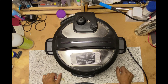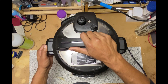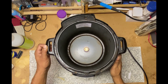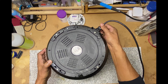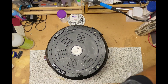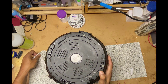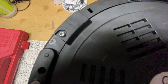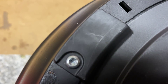To locate, diagnose, and replace a dead thermal fuse, let's take out the top cover. Make sure you took out the cooking bowl and the cooker is empty, then unplug the power — which is very important and you must always do it. You have to remove the bottom cover of the pot.